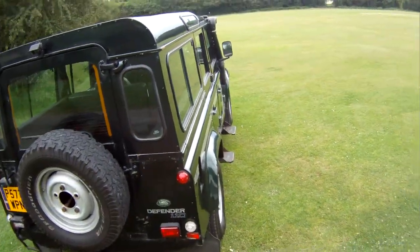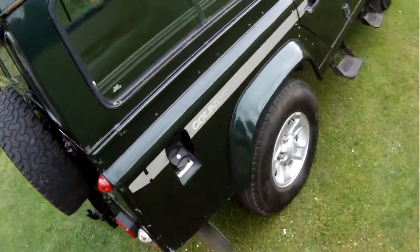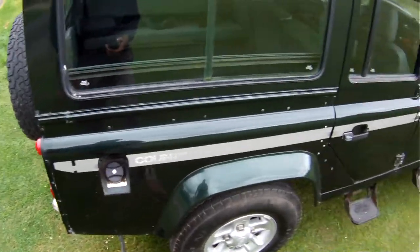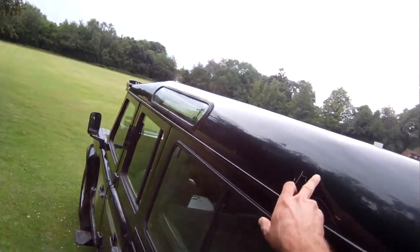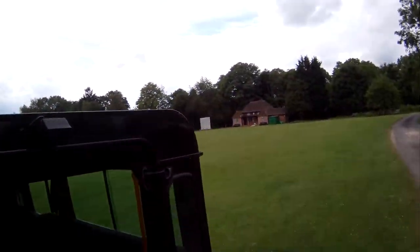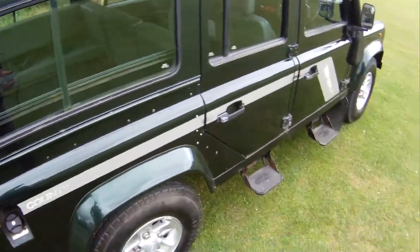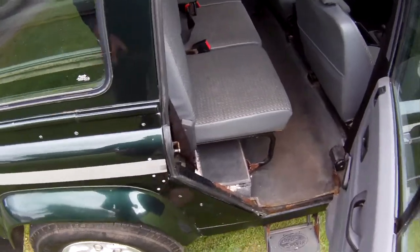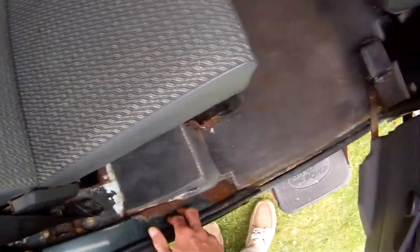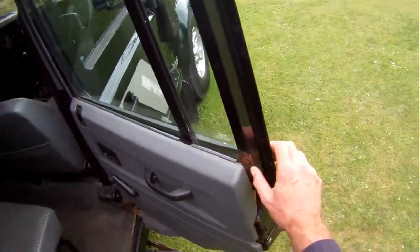Looking down the off side — a couple of depressions in the barrel sides but it looks really rather straight. Off side rear wing — a bit of reaction around there but that's it. One thing we didn't notice before: there's a big scratch on the roof just there, obviously where the roof rack's been taken off, and there's a slight dink in the roof just there which hasn't broken the paint. Off side rear door — the usual bit of reaction on the bottom of the door, and slightly poor paint on the modesty cover. This side is much better on the D-post.